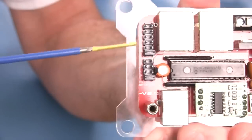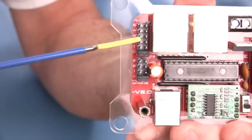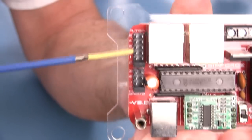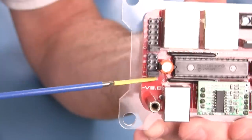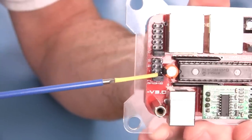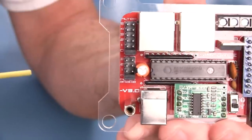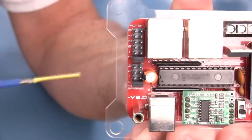I think from the factory, they ship these things on like three or four, and this one's probably maybe on two or three. I'm not sure. But once you understand what they're for, you can back off these filter pins if you want and see where you can go and not get any movement in DI View in your raw signal coming from the actual controllers. Kind of cool.